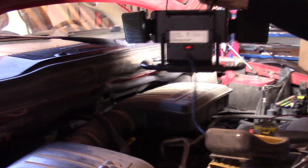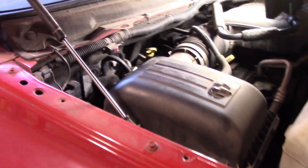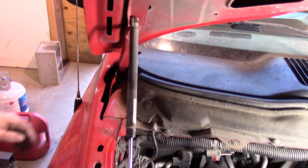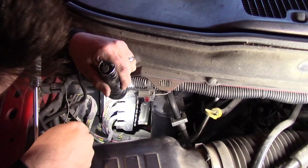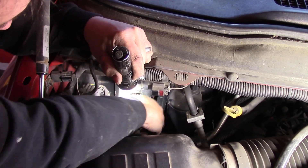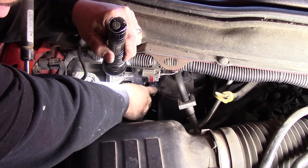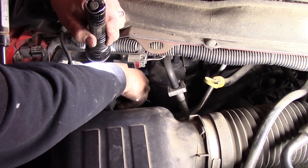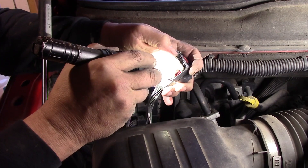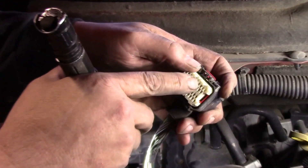Now, that wire I showed you — that pin from the relay — it goes to your powertrain control module right here, and it goes to connector C-3, which is this one. Now, there's a little clip on the side — like a security lock — you have to pull back. You may have to get in there with a little tiny screwdriver, and then you press on the little latch there to get it out. And on this one, it's a natural-colored connector, and it's pin 3, which is that one right there. So you got one, two, three.